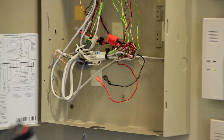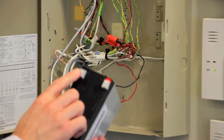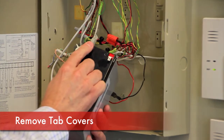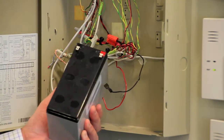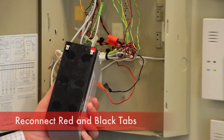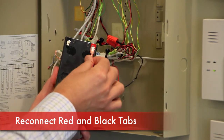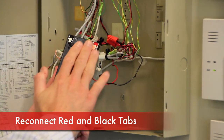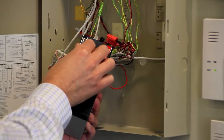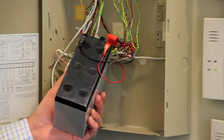Once the wires are disconnected, simply take the new battery, which may come with protective covers over the tabs. You simply slide those tab covers off, exposing the metal tabs. You'll see the red and black indications on each tab. Take the red wire and slip it back onto the red tab, using that same horizontal motion along the surface of the battery. Connect the black wire as well. Once you've plugged them back on, it's a good idea to give a slight tug to make sure that they're holding securely.